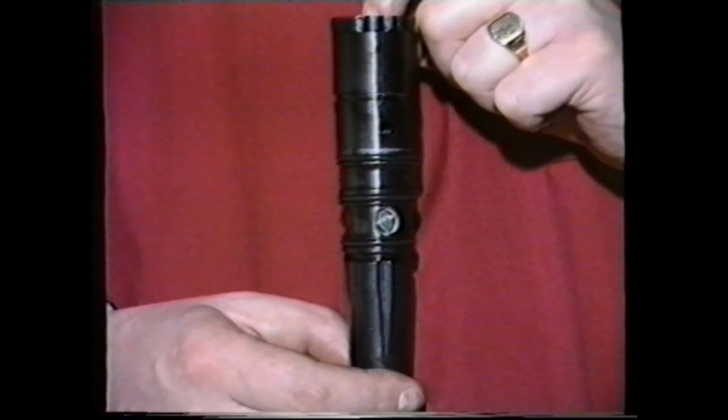The lower seal will allow fuel rail pressure to seep into the combustion chamber, causing black smoke and a drop in fuel pressure with a resulting power loss. More details on this subject will be given in the fault diagnosis section of this program.